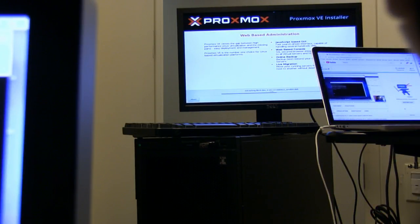The whole concept of this deployment is taking advantage of all 4 hard drives. I did a RAID 5 configuration on them, and I want to install the operating system on a flash drive, right? I want the system to boot into the flash drive within the operating system. That's what I want. And then take full advantage of the storage of all 4 hard drives. I think that is 687 gigabytes. So it's still doing its thing. It's just moving real slow.